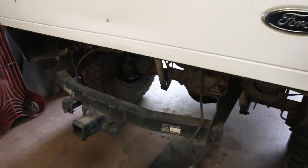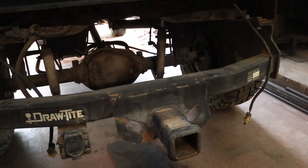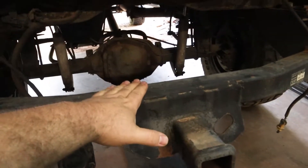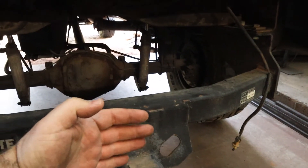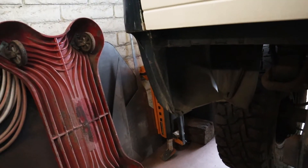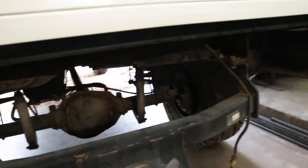So we'll get this truck backed into my little tiny garage so we can start looking at the rear bumper. Here's what we're working with - this is my trailer hitch. I don't have any intention of modifying this, although I could. I've built hitches in the past that have towed well over what this thing's capable of, like dump truck hitches. My plan is to build a plate that's going to sit on this and attach using some of the same mounting points. The winch is going to sit here, the bumper is going to come out just a little bit more, and I'm going to try to make it look similar to the front one. The plate is only going to go out to about here, and then I want to do tubes around the corners. I'm considering cutting this corner of the bedside off completely, wrapping the tube around the corner, having another tube come up and around. We're going to start on the center section with some quarter-inch plate and a couple other pieces.